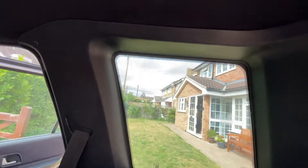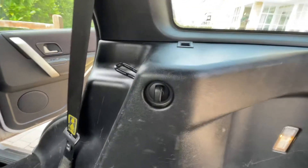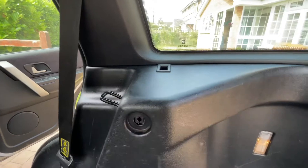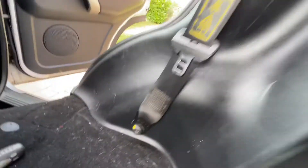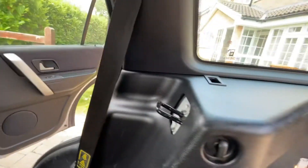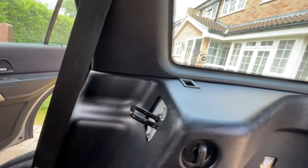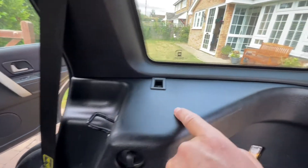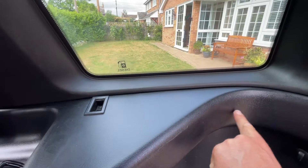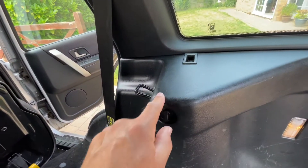Next you need to get the quarter panel plastics out, but take the bottom quarter panel out first. The cargo net hooks just twist and pull out. Pull out the light, disconnect the wires, there's a Phillips screw in the top, disconnect the seat belt, and then lift and pull out the panel. Once that's off, you'll see a black bracing bar on the back which has a cross and screws into the side of the bodywork — undo that and it'll just drop down.